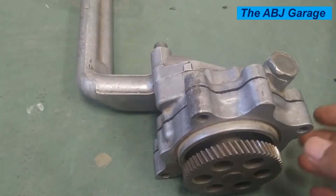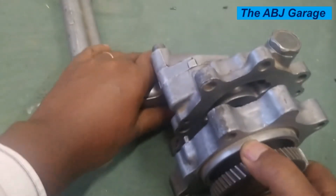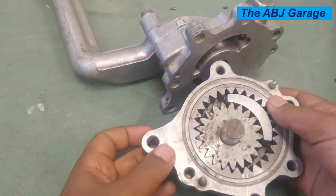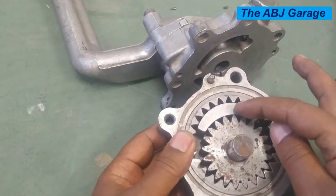When we look at the internal construction of the oil pump, we can open this — it's already partly opened. Let's disconnect this and see the internal construction. Right here we have a gear that is meshed with the outer gear, and right here we have the crescent.